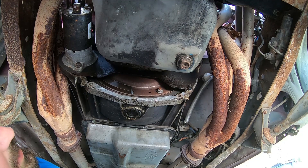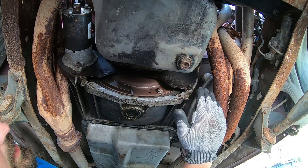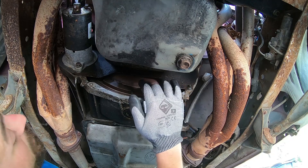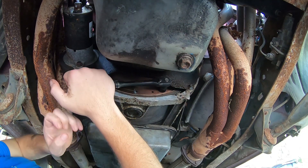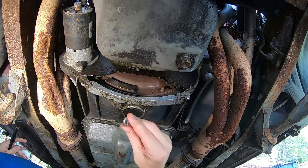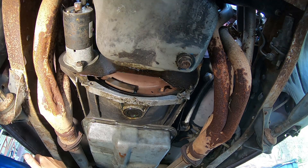This is six weeks later — finally feeling better and getting back to this. I'm hoping I got on tape taking off this plate to give access to the torque converter-to-flex plate bolts. There should be four of these. We've got it locked up front so we're not going to rotate the engine. There's one — now we need to rotate around until we see the next one. I'll go up front and turn it.